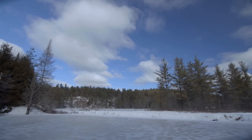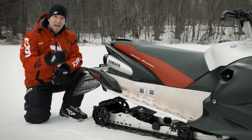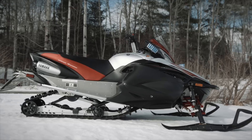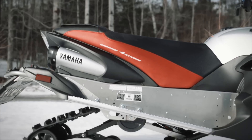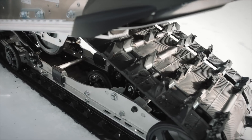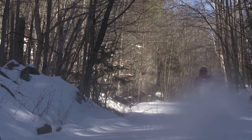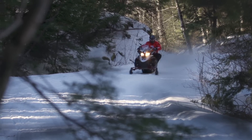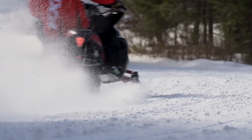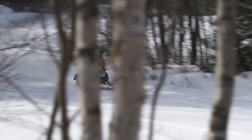The 128-inch track sure helps keeping the Apex hooked up on the trail or the lake, but it's what's inside that track that's a totally different animal. The rear skid is called a single shot due to its use of a single Fox Float 3 VX shock, doing the work of both the shock and the spring. It allows the rear skid to be 10 pounds lighter over the previous version. Truth be told, I think the old pro-action tunnel-adjust rear skid Yamaha used for years delivered a superior ride, and the tunnel-tunable dial was super cool — but more importantly, exceptionally functional, allowing easy changes to the massive Ohlins single-stage coilover.